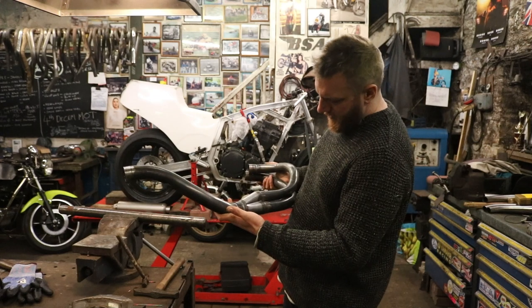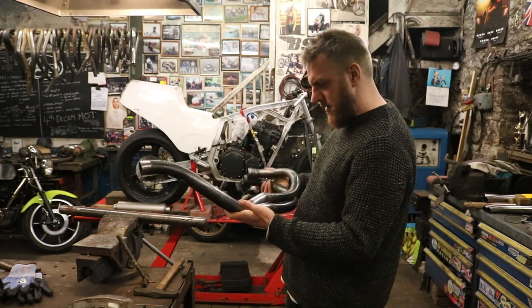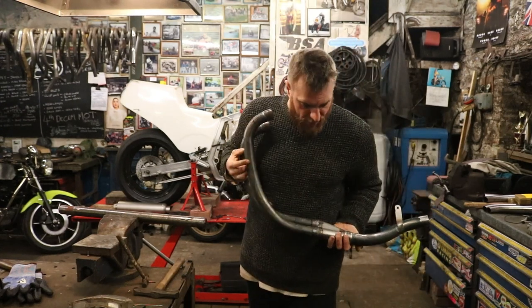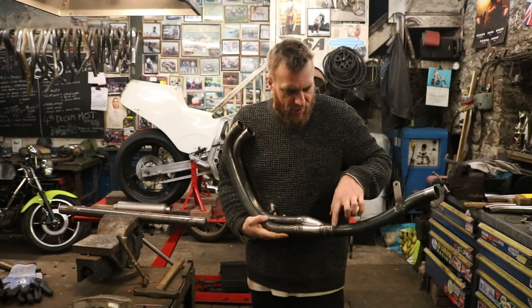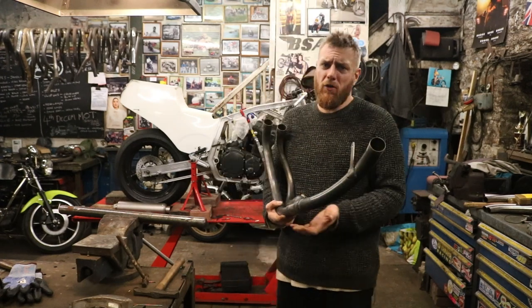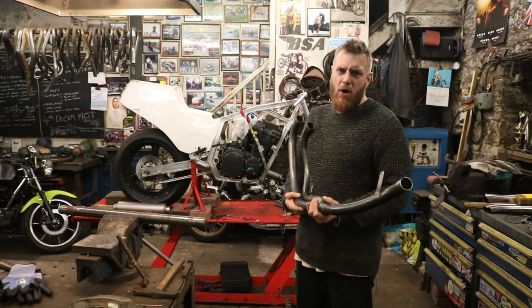This one on front, I can't actually see no marks there. No, that's the one off the back, I tell you why, they look near enough identical. So this one's on back, and I'm going to weld all these on backs, because otherwise they'd interfere. But I'm also going to weld the hooks on the back of the other tailpipe, just so it hides them. I don't need all the springs on, sure. If I can get them around the back, it'd be a lot neater. Bit harder to put on, but a lot neater.